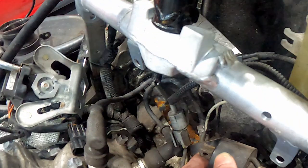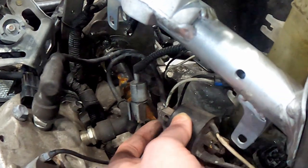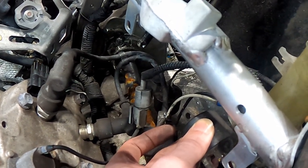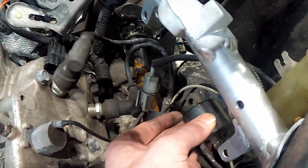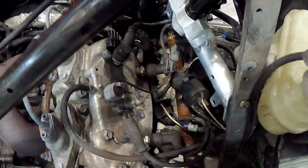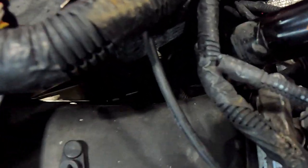Just test fitting the upper steering post - I got the SSI aftermarket bushing in, I just don't have the C-clip on it yet. Test fitting this bar that goes across that the steering post bolts into. I need to order four spacers because this aluminum piece holds the four coils differently than the previous one - the previous one had a separate mount for each coil and these actually stack the coils on top of each other. Also got the lower steering post test fitted. This bolts into the piece back here and I just need to install the other bushing up there, clean this part up a little bit, and the steering post is all lining up down inside the snowmobile as well.